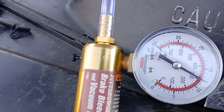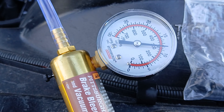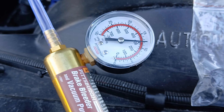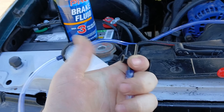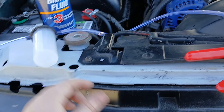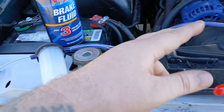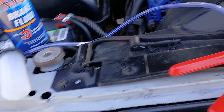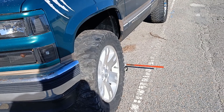If you hold this side down and squeeze, it's got to go through all this hose, but it'll build vacuum all the way up — 30, 25, 20, 15, 10, 5 — and then it'll vacuum out the brake fluid. The fluid will go through here and drip down, and the pressure pulls it through.